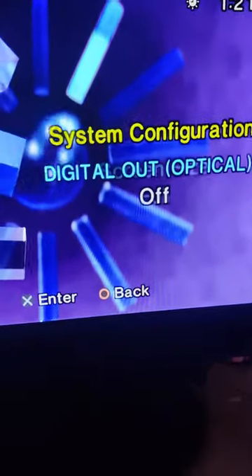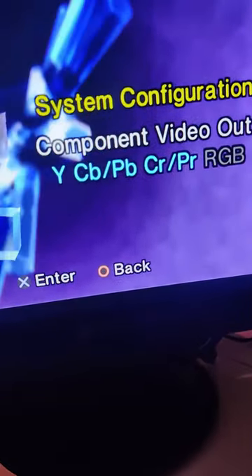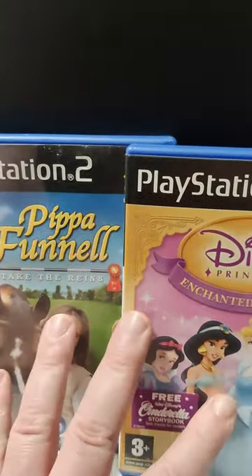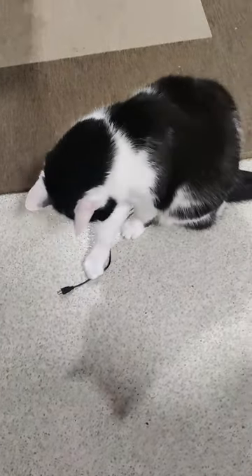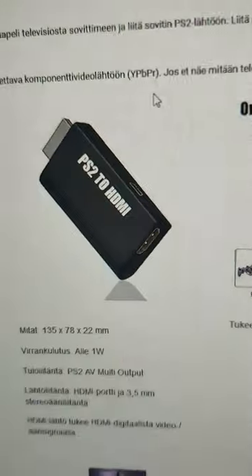So what the heck went wrong? Well, I was supposed to know to go and switch the output mode from RGB to component. I didn't even know PS2 had a component cable, let alone that there is a menu for it. Because, you know, I never spent time on these menus — I played games with this thing. And of course, after checking the manual, there is a cryptic note about this whole thing. But I was distracted by the 5-volt cable thing. So since I can't get a picture, now I gotta go and grab my stupid RCA cable so that I can go to the menu and change the mode, so I can get this thing to function.